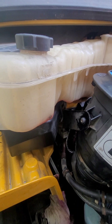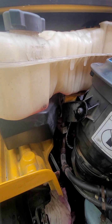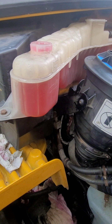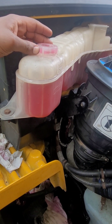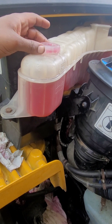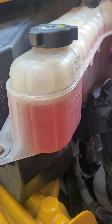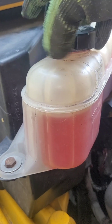Just fill this back up with coolant. It took four gallons to get it back to the full line. Start the truck and leave the cap open so any air that was introduced can exit — it might bubble inside while it circulates through the engine. If you need to add more, you can add more. Allowing it to run with the cooling cap open will let any introduced air out.